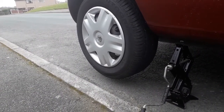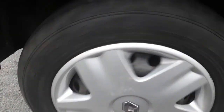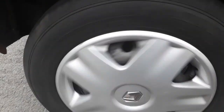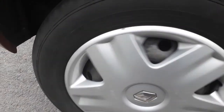Now that the car is slightly off the ground and you've taken the handbrake off, you can turn the wheel. When you're turning the wheel, you're listening for any humming noises or resonating noises coming from the bearing. I'll just spin it for a few seconds and let you hear.